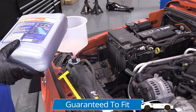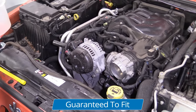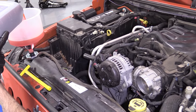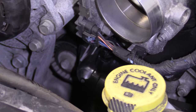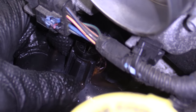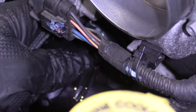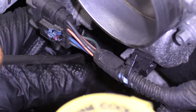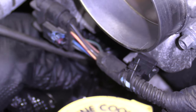You're going to want to make sure you use the correct coolant for the vehicle. As I'm pouring this in, you can actually hear the air coming out of the bleeder. We want to add it — once we start seeing coolant come out of there, then we can close it up. There we go, some air bubbles are coming out — that's pretty good, so we'll close it up. Just take the screwdriver and close it a little bit more, right about where it was — that's good.